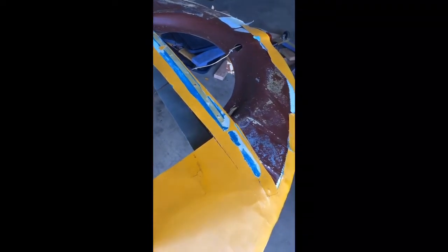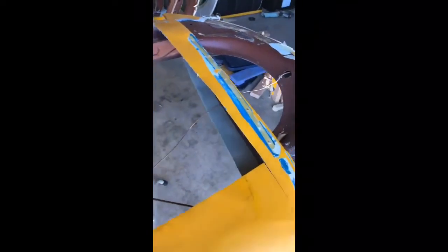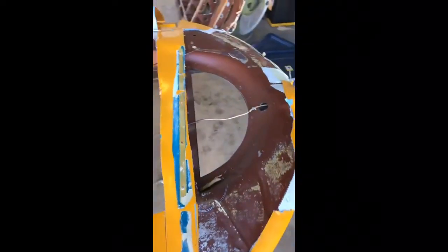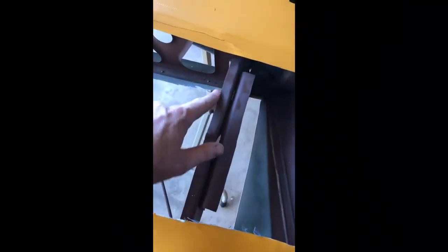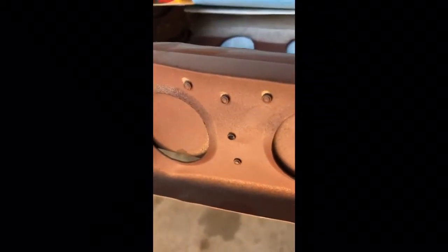So this is my good left wing, or at least I hope it's good. I'm starting to peel apart the skin out here at the wing tip, and I noticed out here on this little wing tip spar, there's a bulge right there. What in the world is this thing? Well, somebody riveted a doubler on that, and their choice of rivet — pop rivets.